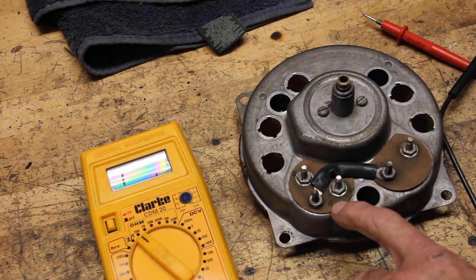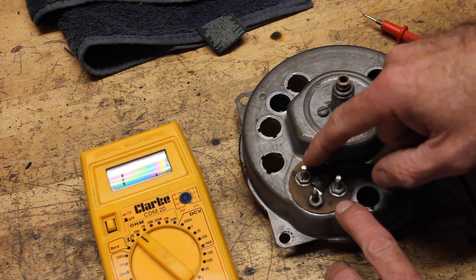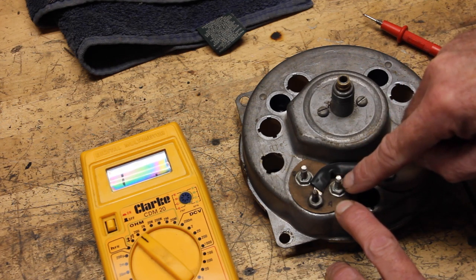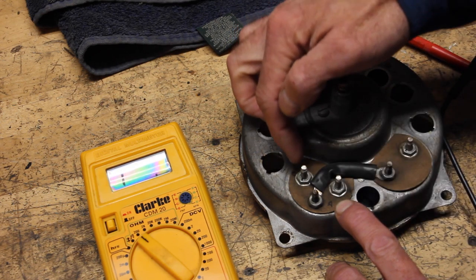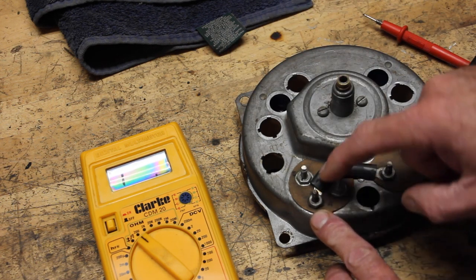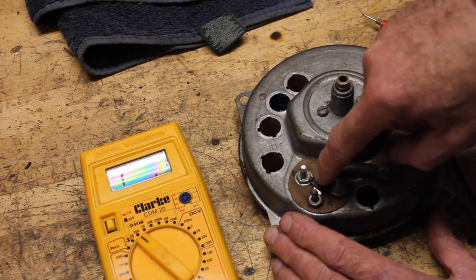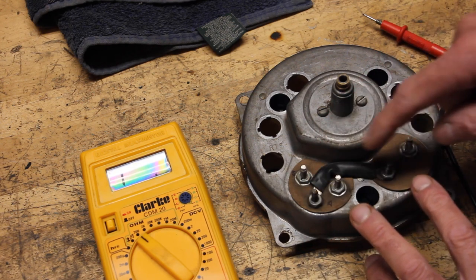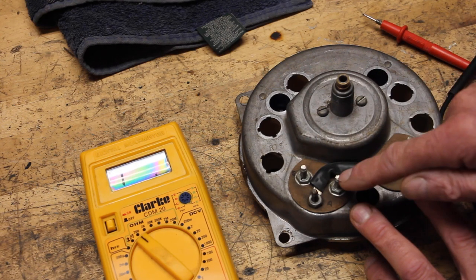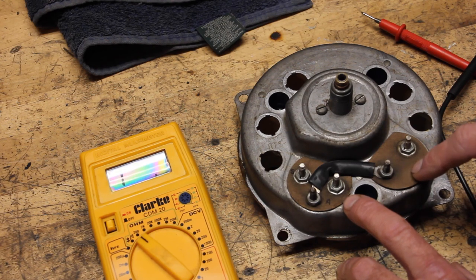Now that the posts are cleaned up, I've marked the three posts on the fuel gauge. On this brown cardboard backer, there should be an imprint of each letter. This is the I post — ignition, the hot wire. This is the S post, which goes out to the sending unit — a pink wire in your wiring harness. This is a red wire. The A is the jumper piece that powers the temperature gauge. This bimetal jumper — more like a plate than a wire — connects the temperature gauge to the fuel gauge and converts the 12-volt feed coming in through the I post down to 5 volts. Otherwise, you'd toast your temperature gauge.